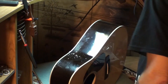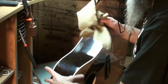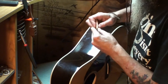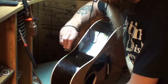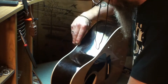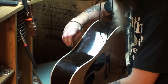Welcome back once again. I took a razor blade to it again because it was slow going, taking that much down. So now we go back to sanding — still got 1500 grit on here. I'll sand in small circles. There's still a little tiny bit of an edge right there, and I'm hoping this sandpaper will take that down and be rid of it once and for all.